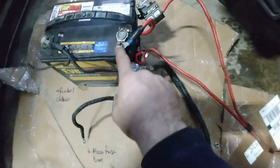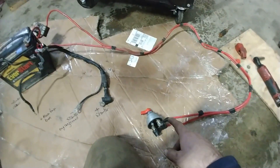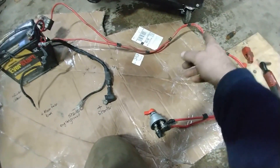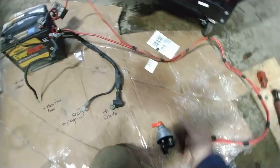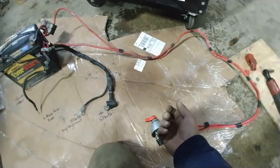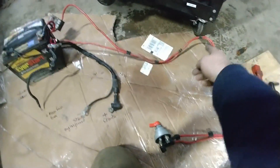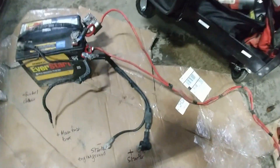The main issue is that from the battery to the kill switch you have a big live wire going through the car and through your firewall. The issue — like I had at a Diffie — is when the grommet fails and that wire shorts to the chassis, it shorts before the kill switch. So you can try to kill the switch as much as you want, but it connects the battery directly to the chassis and the battery and wires are going to melt.